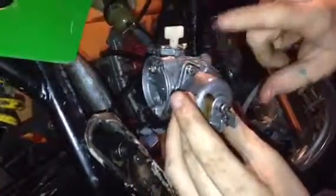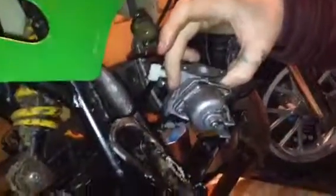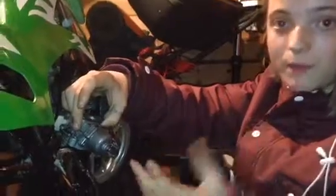Now, if the cameraman comes over here, you can see I've got the whole carburettor here, and all you've got to do is take these nuts off. You've got that screw there and that screw there. As you can see, it is full of petrol, so that's why we've got the rag, and that will save us a lot of mess. You can dry that out, but don't use heat, just leave it on a washing line. If you use heat, it's petrol, it will go up.